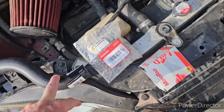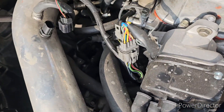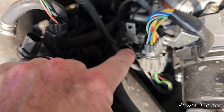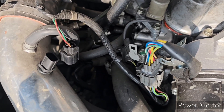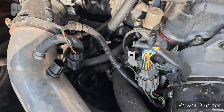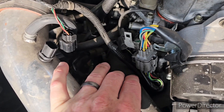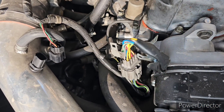The radiator cap and the hose are the cheapest parts. To replace the thermostat it's really easy. We're gonna remove the intake just so we have some room, but it's right here and there's just two 10-millimeter bolts. Tools for this: just a 10-millimeter socket, ratchet, and extension. And if you gotta remove the intake, a flat tip screwdriver. We'll probably leave the hose attached if possible because usually when these are a little older they're really hard to get off and you don't want to mess with it.